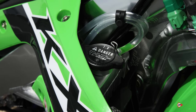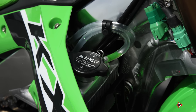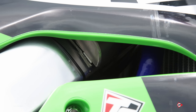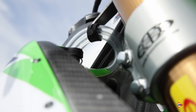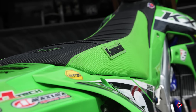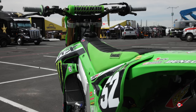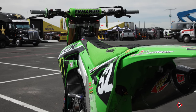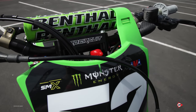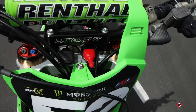We go up on pressure on the radiator cap — we're at a 1.8 cap, and we even have higher pressures for hotter, muddier conditions if need be. We run a pin through where the radiator cap sits so their knee can hit it or something else and it can twist it off — we try to prevent that. We run a catch can: if the bike overheats it'll push coolant into the can, and then as the bike cools down it'll suck it back in so we don't lose that coolant. For the seat, Carson doesn't have a preference really — we run a Guts lightweight seat foam with a Throttle Syndicate seat cover. He's not picky but I try to keep it fresh and consistent so it's not too blown out. We run data on the race bikes at all times, so we have a logger on the front that records everything the bike is doing, and after every single session we have GPS data and everything else on the chip, and we monitor it every time the bike goes on the track to catch any issues before they actually happen.